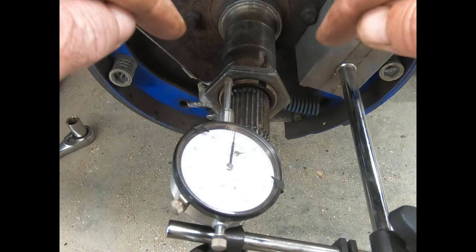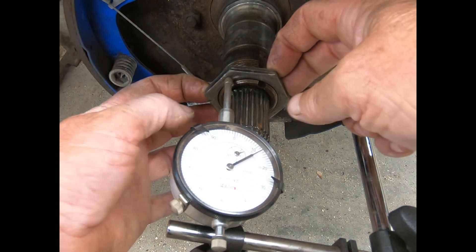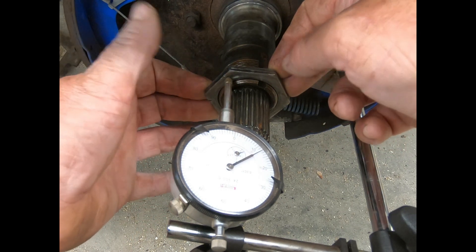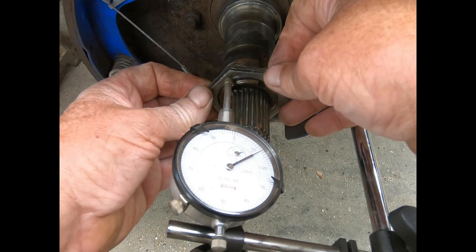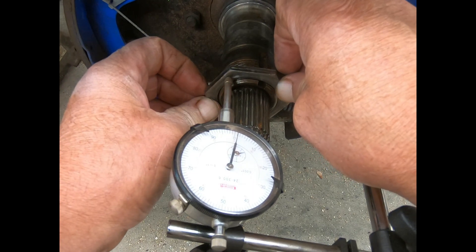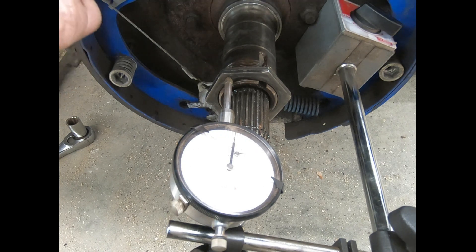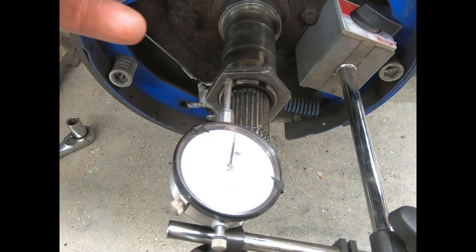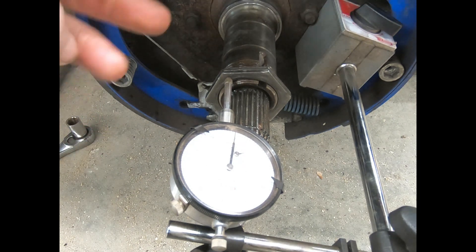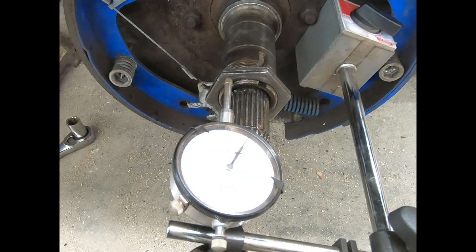The inner nut is there, but when you put your other nut on, this is what you're dealing with — right now it's at 12 thousandths. When you shove the other nut and washer up against it and tighten it, it goes to 1 thousandth from 12. That is why you back it off an eighth before you tighten the jam nut — we'll snug it until we like the feel of it, back it off an eighth, then tighten it up.